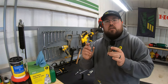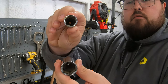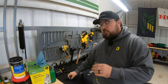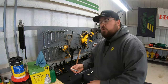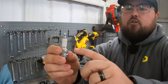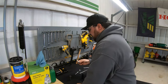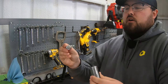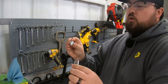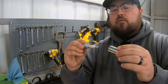What makes these unique to the spark plug is that if we look right down inside there, we can actually see that rubber isolator. The reason we need these specific sockets is whenever you look at how a spark plug is made — we have this glass body here, then we have our two metal ends. We want to make sure we are securing it on the glass and not causing any vibration or wiggle that could crack and break it when taking it loose.